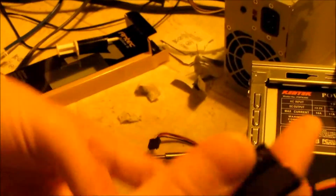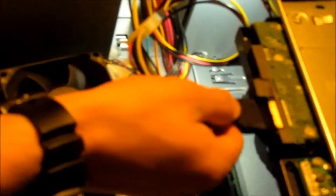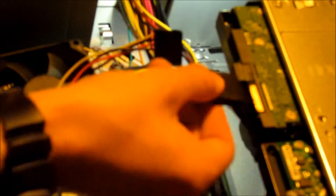Now I've got the cable that will be plugged in to the graphics card, so I'll set that in right there. This one came with a Molex and a SATA connector. I'm going to use this one and hide it in there. Make sure you plug this into your graphics card, then set that one right there. Make sure the cables aren't interfering with any of the fans.